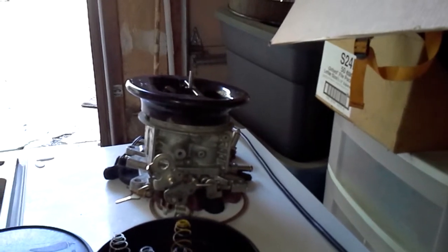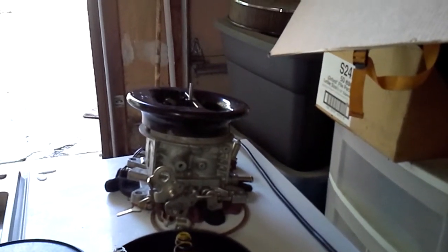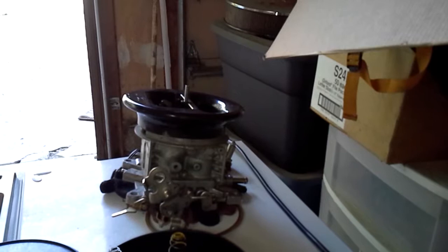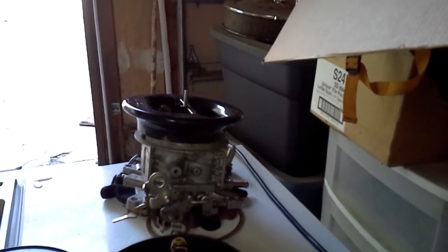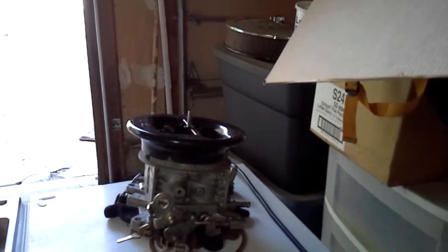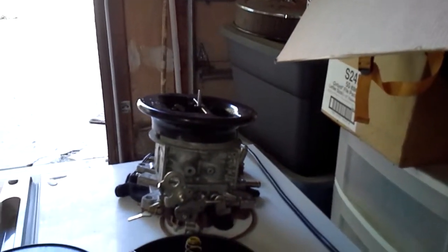So I'm thinking, is this carburetor too big? Why is this thing not even opening the four-barrel? I did a little test and confirmed it was still doing it — you hit it from a dead stop or a roll and it just jumps RPM until it hits a dead spot right around 4,800 to 5,200. But once it clears 5,200, that engine will sing as fast as it wants to all the way to 6,000 RPMs.